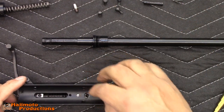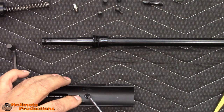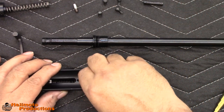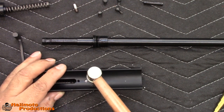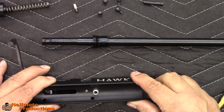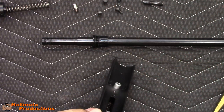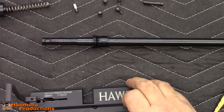At this point I'll put the O-ring back inside. Make sure the O-ring sits right down inside and it doesn't go partially into the hole — we want it sitting right down inside. Then we're going to take our transfer port and line it up using a brass hammer, just tapping it down really light, nothing big. Just tapping it into place, knowing that everything is straight, aligned like it's supposed to be, and ready for reassembly. I'm looking down here to make sure we're not tipped left to right. It's a pressure fit on this thing, so it's good to go. Everything's good — this is it. Now we'll continue back on reassembly.